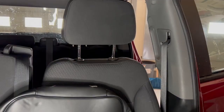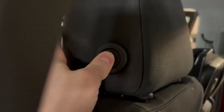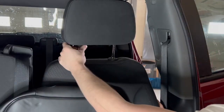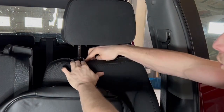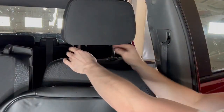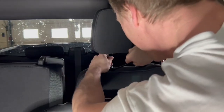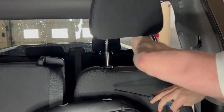First thing I'm going to do is take the headrest off — these headrests are not the easiest things to take off. There's a button on the side, you're going to click that, push it up, and then the things at the bottom you're going to unscrew counterclockwise. When you're looking underneath you'll see a silver pin — it's going to be a circle-looking thing — you push that to the side and that's going to unclip the headrest and allow it to come up.